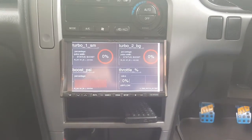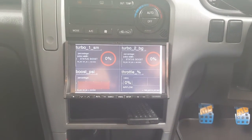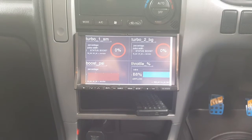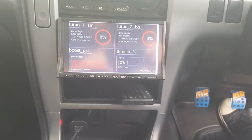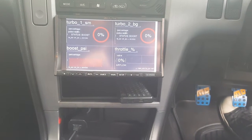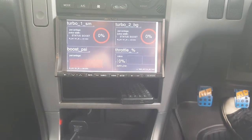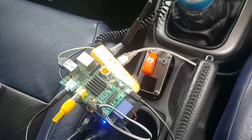Subarus are unique in the OBD2 port, particularly early models. Subaru wrote and designed their own software that had a serial connection back to computers outside their system. I had to reverse engineer how to use that — it's called the SSM protocol. That took a little while, which is why it wasn't just a plug and play solution and I've gone with a Raspberry Pi setup such as this.